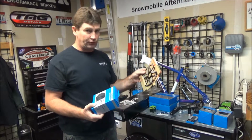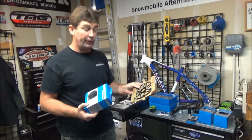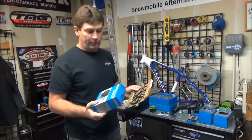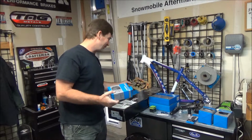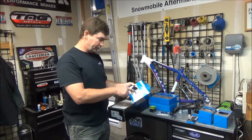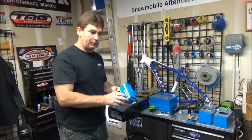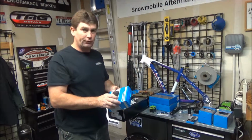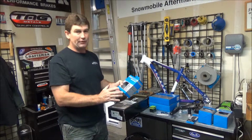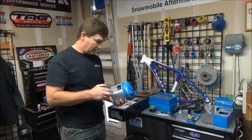That makes that single 36 up front work really good, where you actually have a bit of a granny gear out of it. He'll be able to climb some hills. He's a little guy, good gearing. He'll be able to make it up hills like a billy goat. I know Mike. It's nice up top though. Went with the 11-34, so he's got the 11 with the 36. He'll have a decent enough high speed. He'll be able to go anywhere he wants to go as fast as he really wants to go. Then the 42 is going to make him a nice gear ratio for climbing with. So that's going to set up really well.